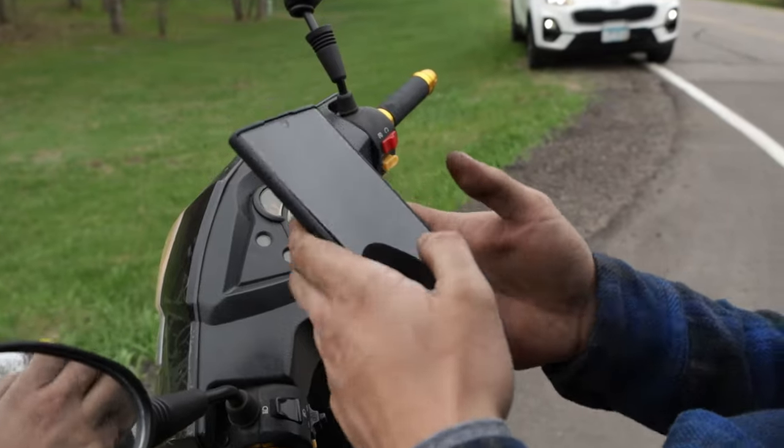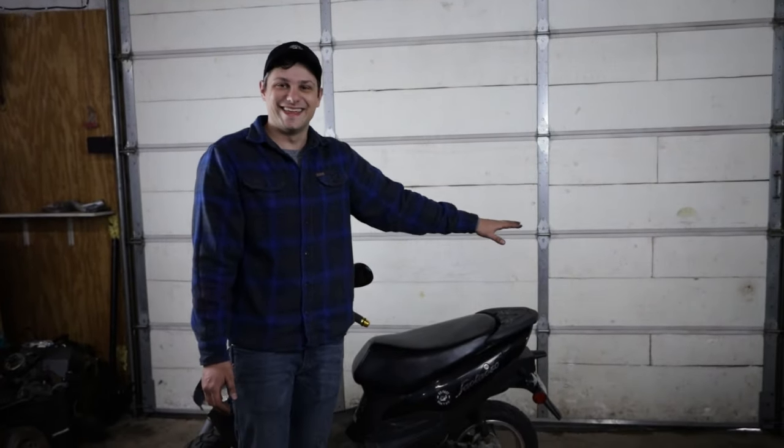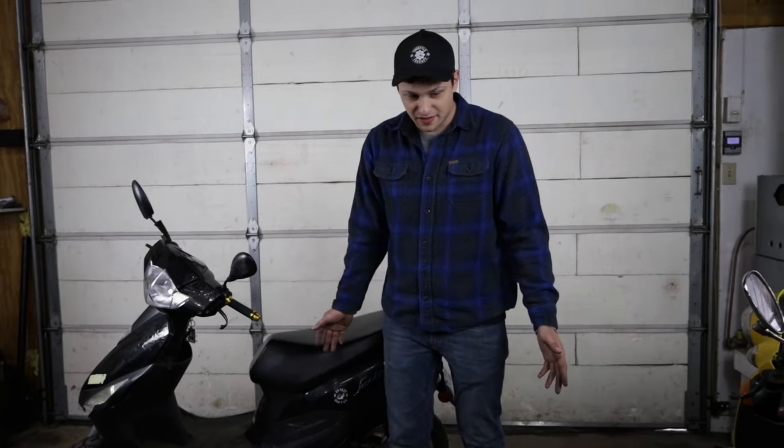Interesting — we went a lot slower. The top speed was actually 32 miles an hour. And I hear there's a rule on slider weights where whatever number you pick minus one — so actually four gram weights. I don't think that's enough for this scooter. We lost 10 miles an hour of overall top speed. I would get these weights again, but I would get them heavier. I don't like these weights at all — they're probably just fine for some people, but it didn't do it for me. I'm going to need a heavier weight — probably going to order those other weights and then go from there.